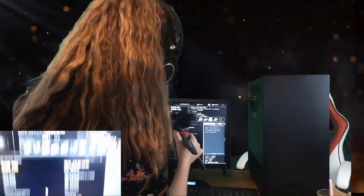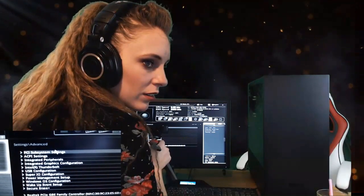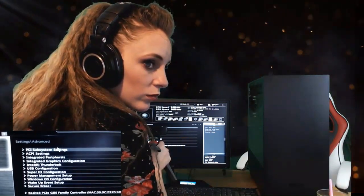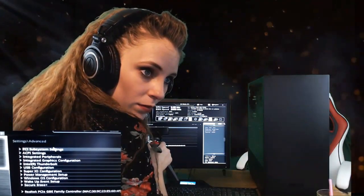The 8192, I see. Why is it? Oh, 8 gigs. We didn't get 16. We got 8 gigs. That's right. I forgot. PCI subsystem settings, ACPI, integrated peripherals, integrated graphics configure. We're going to have to go through most of these one by one.